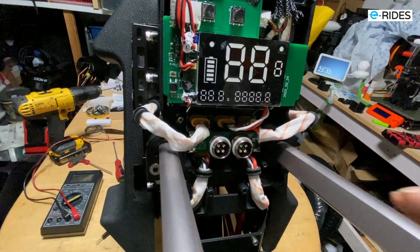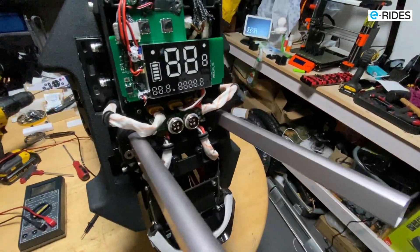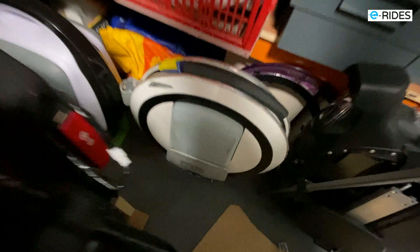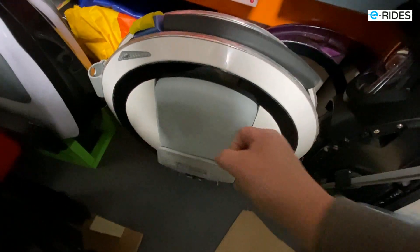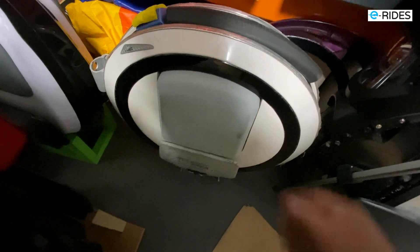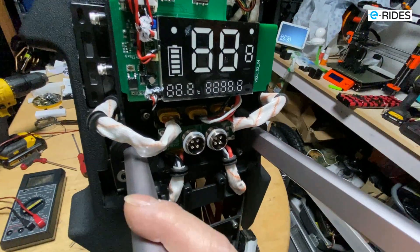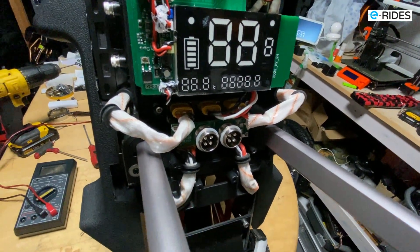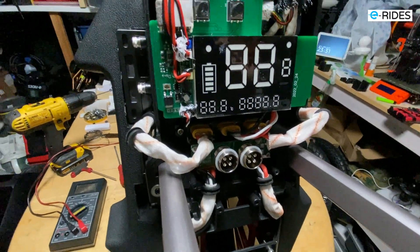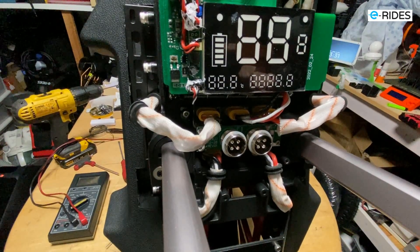I don't know if this is how they want to do it — to me it's gone backward. Like the old Ninebot, there used to be just one pack of battery. If the pack goes, the wheel drops. If there's not enough power, the wheel drops. So here, if there's not enough power it will drop because there's effectively only one combined pack. So if you ride at high speed on low voltage, it will drop — that is by experience.